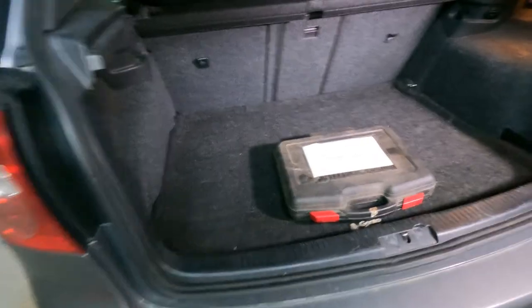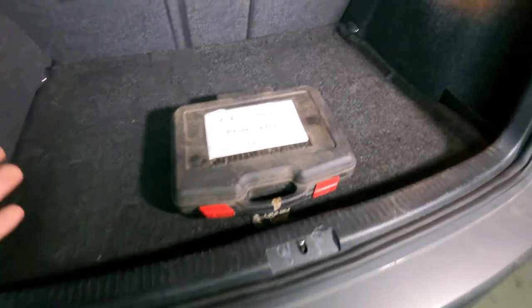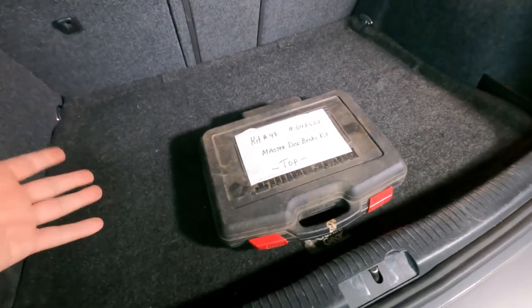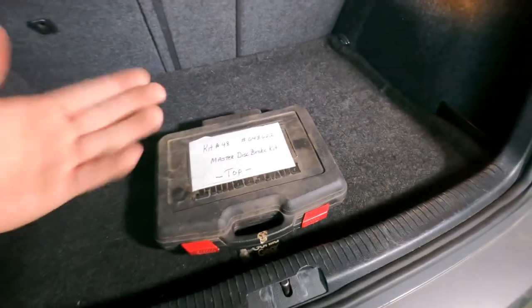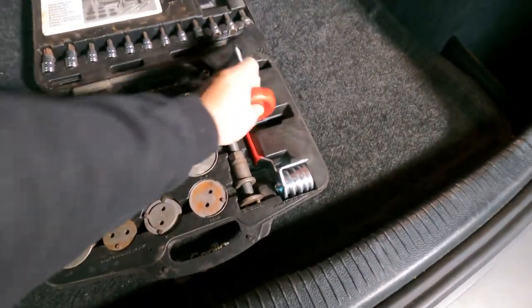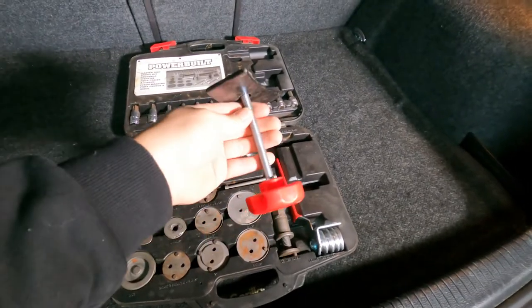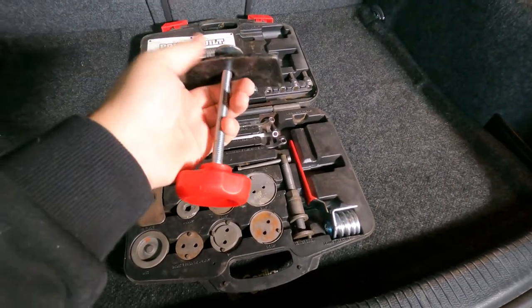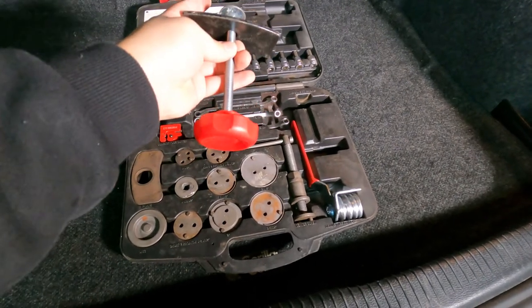I did a little bit of research and I'd like to share this with you. You could just buy what I think is called a retractor tool or something like that — it's like seven bucks. However, not all tools will work on a VW car, and I will explain. This is the tool that I rented from a local auto shop. I'm sure you can rent one at your local auto shop as well. You just pay the price of the tool, and when you're done with it you return it with the receipt and they'll give you a full refund, which is pretty nice. The very basic piston repositioner or retractor tool is something like this — when you torque it and try to turn it, it just pushes the piston back and that's it.